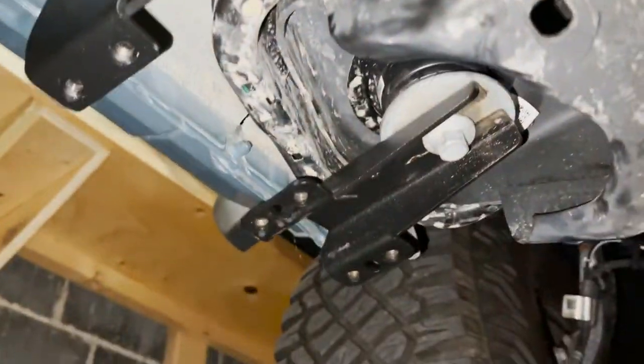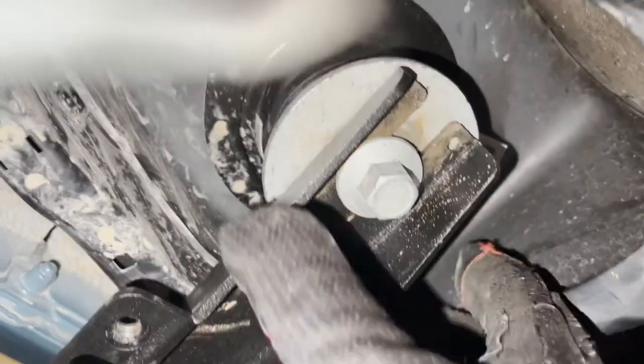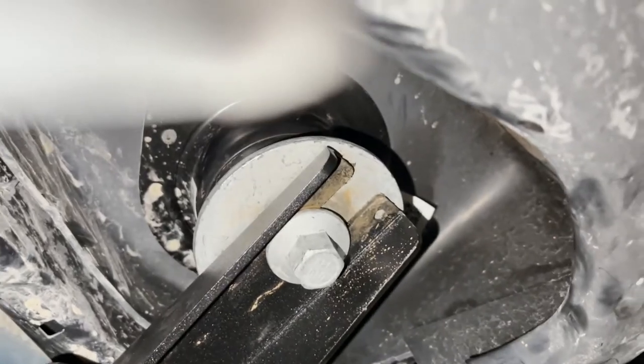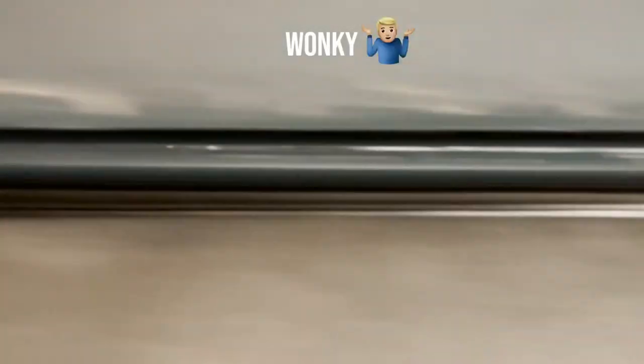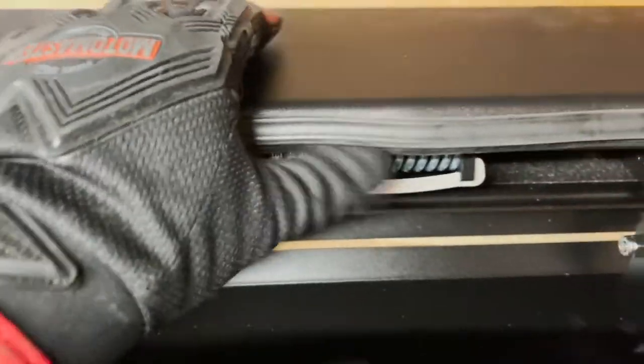I had a heck of a time getting these mounts on the body bolts on this side of the Bronco. A quick call to Rock Slide Engineering revealed that the reason the washer wasn't pushing up is the threads from the bolt holding it down. So instead of trying to shimmy the bracket in, I started rotating it, using the threads to help get that washer up — and that made it so much easier. One thing to note is the rubber strip you have to put on to protect the Bronco. I didn't really know what I was doing the first time so it wasn't as neat, so make sure it's sealed and put on properly before you install the step slider. Just double check it.